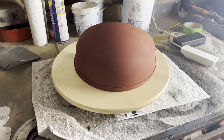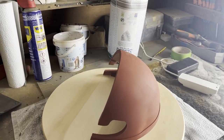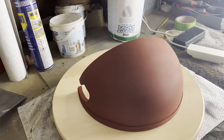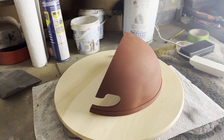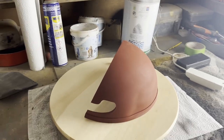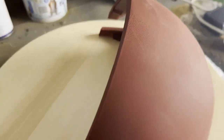Welcome back to the armory. We're getting back onto this helmet build. Right now we've got to a stage where it's all been primed up. I'm probably going to put another couple of coats of primer on, but I just want to show you what this looks like before I start sanding. I'm going to give it a wet sand. I'll show you some of the imperfections it has at the moment, and then what it looks like after the wet sand. Then we're going to start with a gray — I'll probably use the red primer until I'm running out, I've only got a little bit left — so we'll go red primer again before we do another wet sand and then go gray primer.